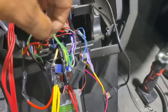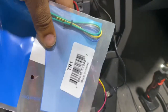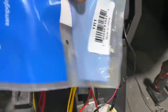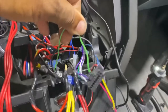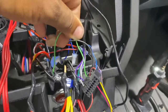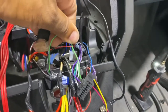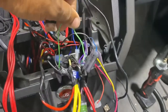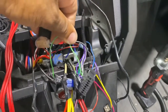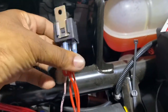Plus it will only work the first time you cycle the ignition. So you either have to run a toggle switch or use something that will automatically toggle the emergency brake. We constantly have customers coming in saying they can't add Bluetooth, can't watch videos, or the DVD says error — that's because of this wire. You either have to hook it up to the actual emergency brake, a toggle switch, or some sort of override. Do not ground this wire.